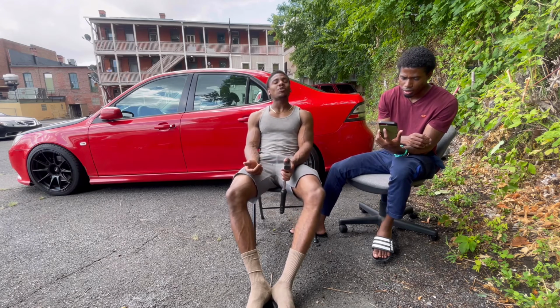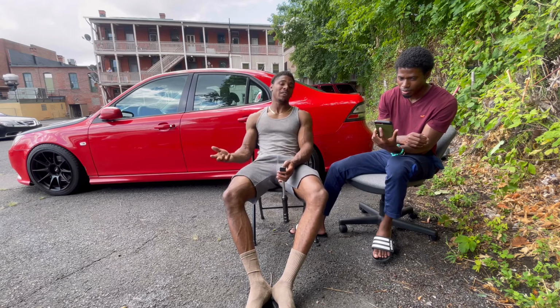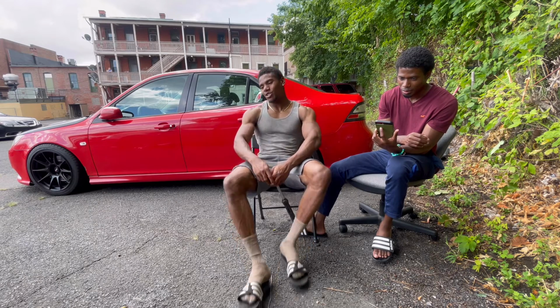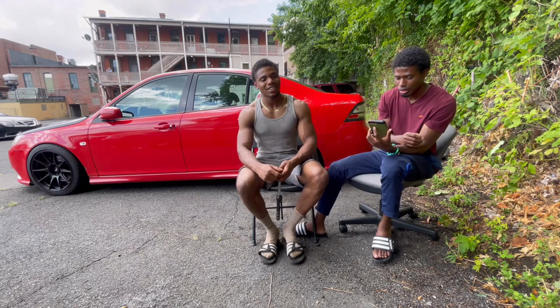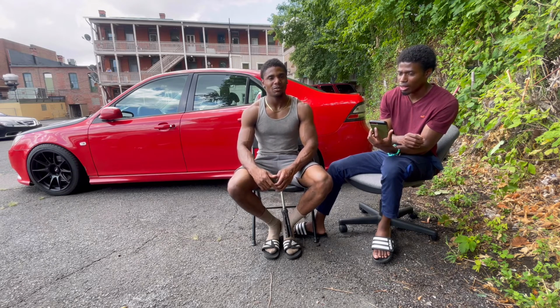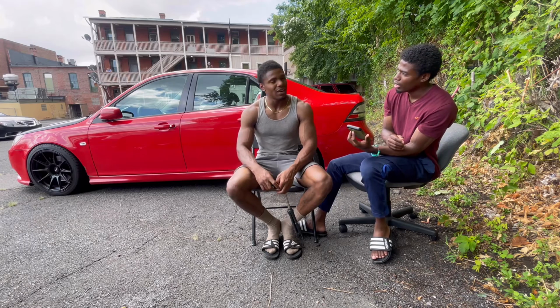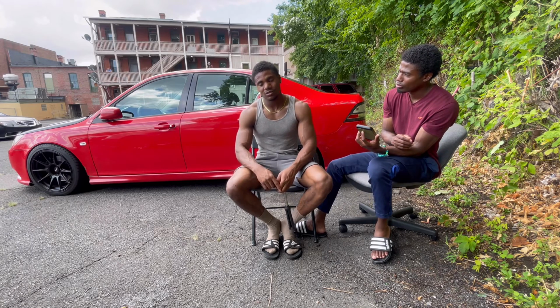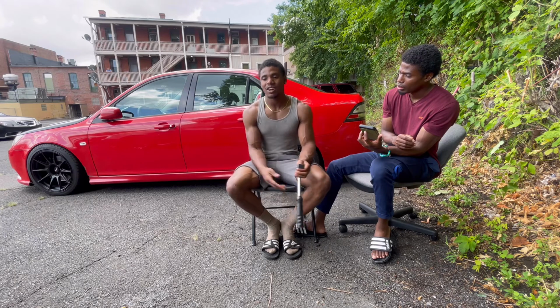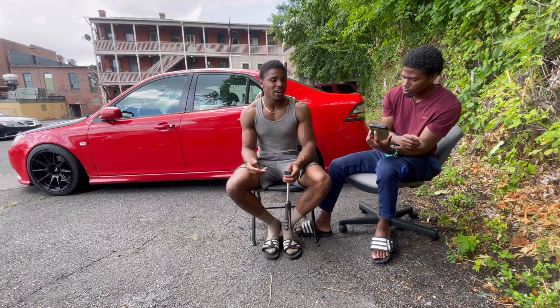Yeah, I don't think we've reached the full potential. We could obviously keep turning it up, and then we'll eventually find out. But I don't think I actually know the full potential of the car yet. So far, the car has made well into the 500s, based on, like I said, the amount of air the car flows. It's moving 56, 57 pounds of air. If you calculate that into horsepower, that's around 560, 570 to the wheels.